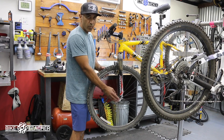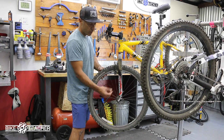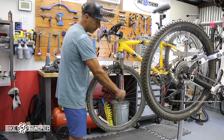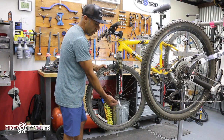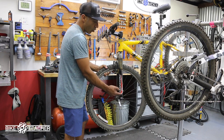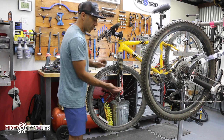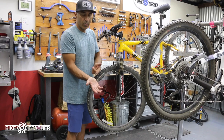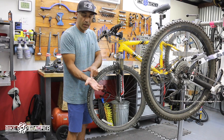Overall the pressure may be okay, but it's just in a very poor position where I can't get a good grip on it with my fingers. So I'm going to open this up and turn it slightly, so when I do close it, it's going to be more straight up and down away from the fork — or if it's for the rear, away from any part of the frame. I'm going to use the palm of my hand, and you might hear some people say it should leave a little indentation, a slight mark in your palm.